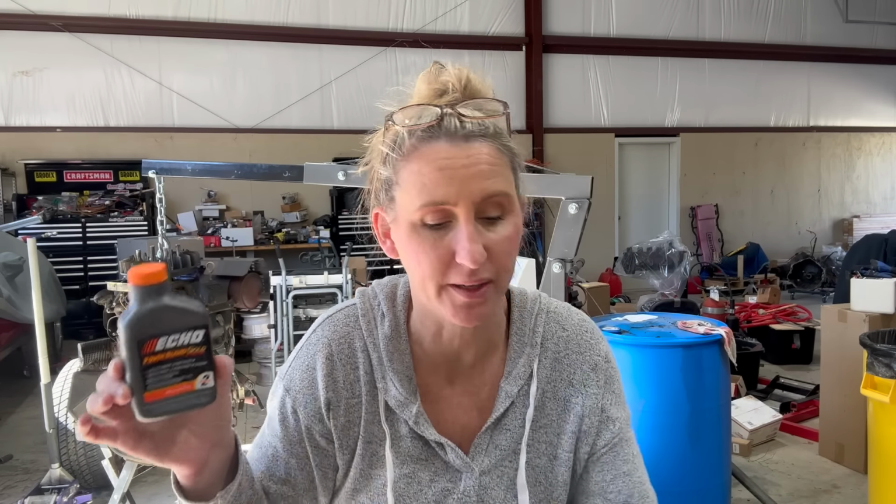Now I'm gonna let you in on how I mix my 2-stroke gas, and it lasts for years. First off, I don't buy ethanol-free fuel. It started off with just a lack of ability to get it, and then it ended up that I found what works and I'm just sticking with it. So for example, at my shop, I would buy 2 gallons of 87 or 89 octane. I would mix a 5.2 ounce bottle of the Echo Power Blend and give it a little squirt of Ethanol Shield. And I know a lot of you are going to say, I don't believe in those snake oils of fuel stabilizer, but I'm just telling you what works.